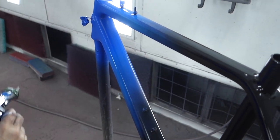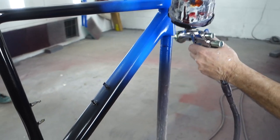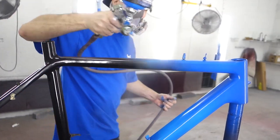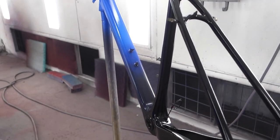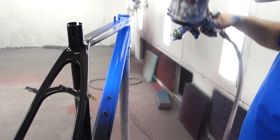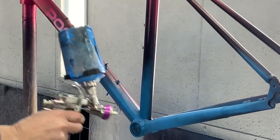Once you start fading, work yourself around the frame — from the bottom to the side to the top to the other side — to make sure the fade transition is uniform across all tubes. This is going to take time and patience, realizing that it's a fade paint job and no one will really know if you meant it to stop at a certain point. Keep working that fade nice and slowly, evenly distributing paint around all tube sides. Periodically check it and look around the frame to make sure it's even, continuing to progress the fade lower if needed. If you want to fade another color from the back or bottom, do the same process — start at the back, cover that area fully, then fade up to where it mixes in the middle. Keep in mind certain colors mix better in the middle than others, so consider that when picking your colors.